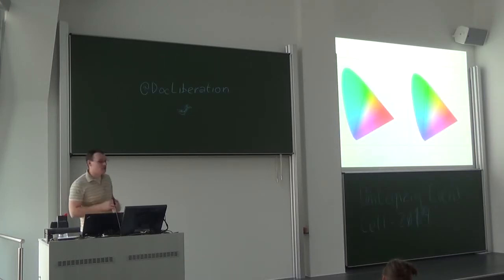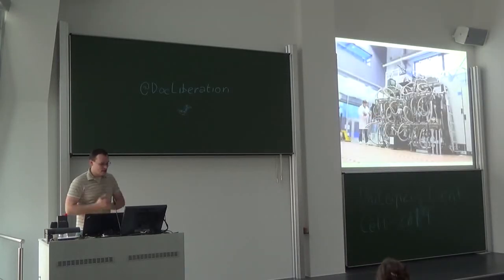Now, colour geeks recoil in horror, but this is my way of showing it: the horseshoe is all the colours that you can see, and the triangle is all the colours that the display can display. So you can see that the difference in colours isn't slight, it's dramatic. With the advent of OLED, it has increased the number of colours that we can display by a long, long way. So how do we solve this?